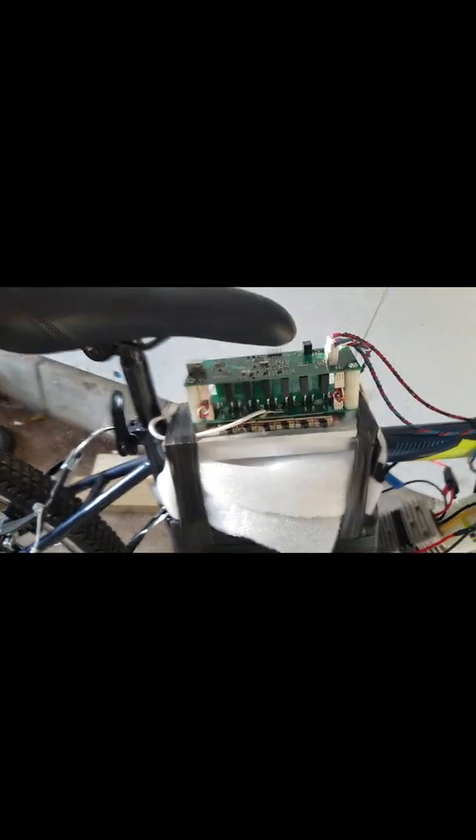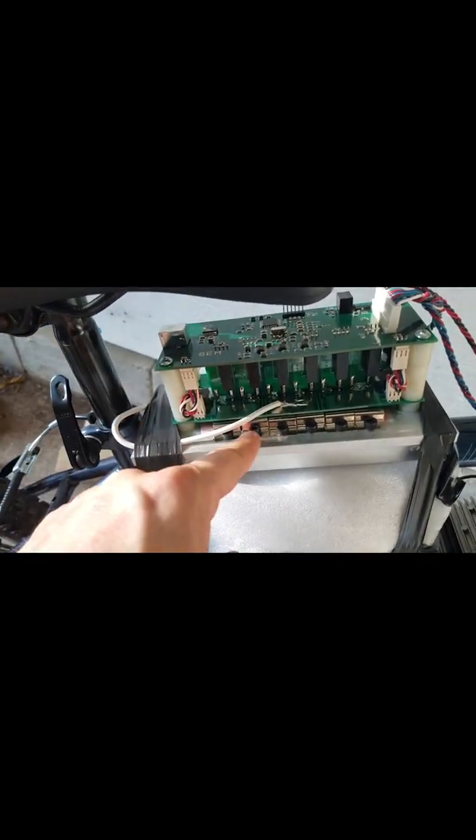Okay, I'm back again — now it's charging. Here's the controller. Three phases: there's U over here, V, and W. And on the U and the W — see that in there? Little current sensors. They're minus 100 to plus 100 amp.